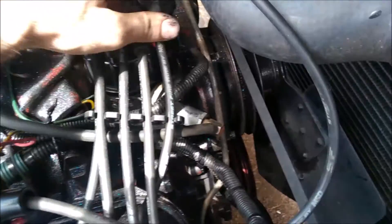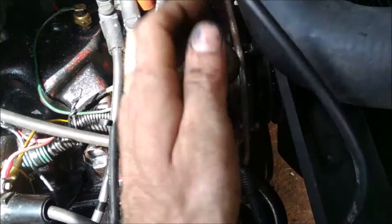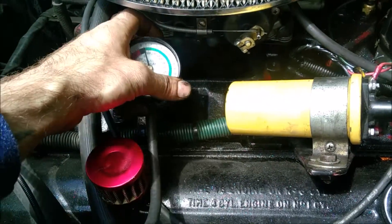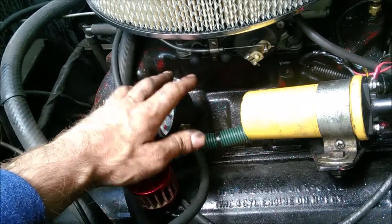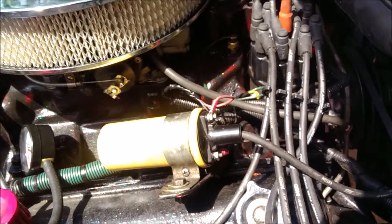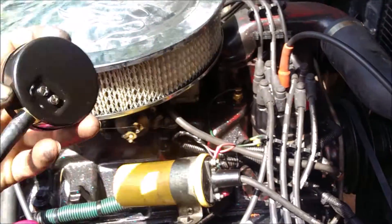I'm going to make a little bracket to hold this all neater later, but it's all installed — we haven't tested it yet. We're going to need to adjust the distributor; it's slightly loose. About there is right — these two are almost straight with the front. We'll hook up our vacuum gauge to any vacuum port except the PCV, because that's always going to be open and sucking through the vents. I've hooked it up to the brake booster line, since mine slightly leaks.